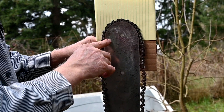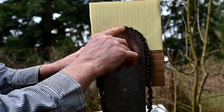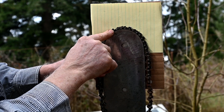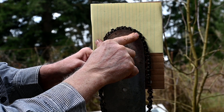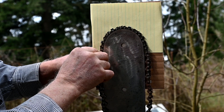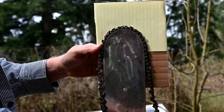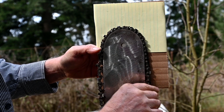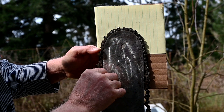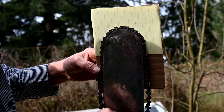Here's the next chain. This is again a lousy cutter because of the rakers on this thing — you can see that tooth sticks way up here. It does have a tooth, then a safety link, then a cutting tooth, and another safety link. They have this edge with little bevels cut into it — maybe just to keep the chain clean. You can see that almost any position, the tooth can only cut in a very small range. Just very little cutting, and it's designed to cut without having a tip in the wood.